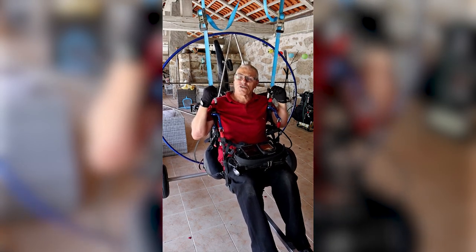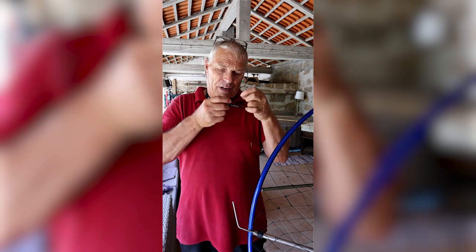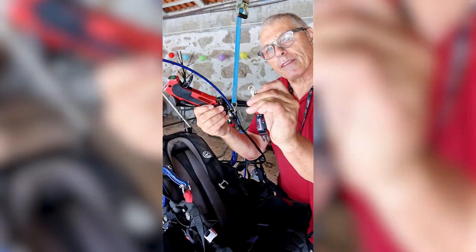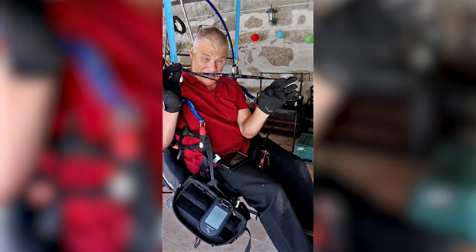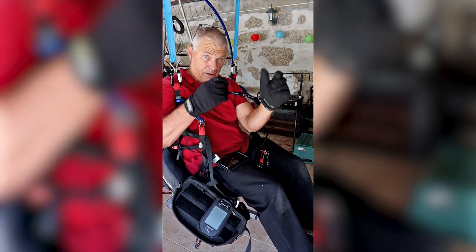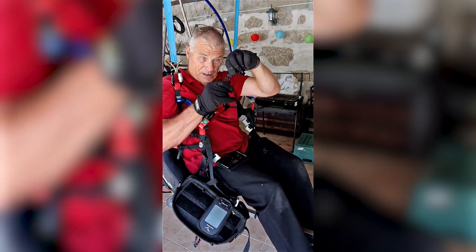It can never happen to me because I use a lanyard, and it's really important that you get one that separates. Connect the small section to the throttle, take the other section, double up on it, put your wrist through so that it is nice and firm, take hold of your throttle, and connect it up.